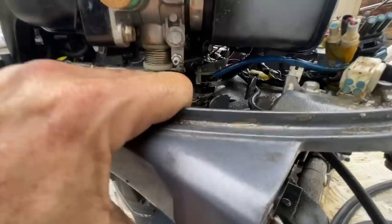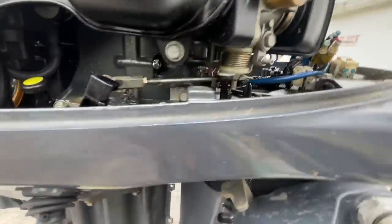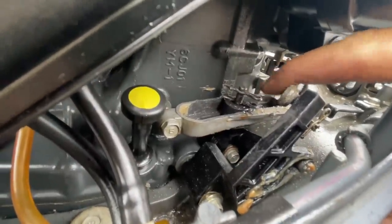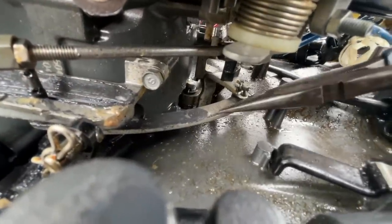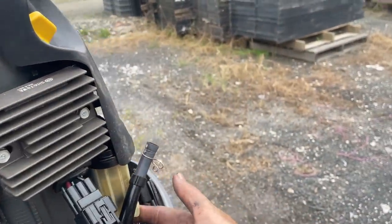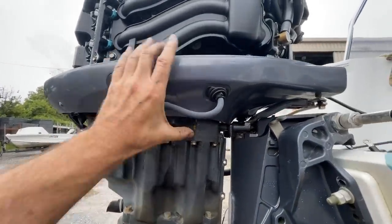All right, next thing I do is look at this gear selector under here. Obviously this is some sort of in-gear, starting gear, neutral switch. But I think if we just unbolt the bracket from the block and then the arm from here, we should be able to lift the power head up and leave all that behind. Okay, in here, I'm going to take these pins out so that we can separate the gear selector from the block. Having a look at it, I'm going to take this whole arm out by undoing this other R-clip as well. Okay, next up is wires for the trim tilt. We'll leave that behind. It's in the lower cowling, a few more plugs, water sensor for the fuel filter right here. Now the bolts down the bottom here, and then we'll gently lift it. If we've missed something, we'll undo it, but I think we've got most things now.